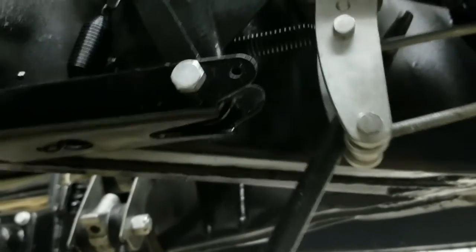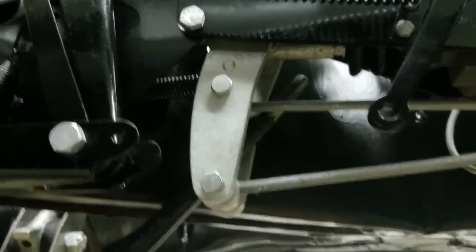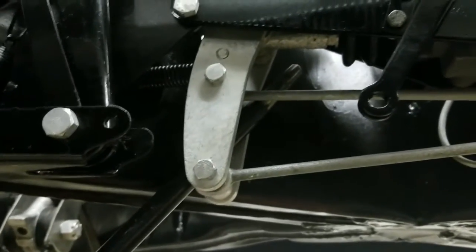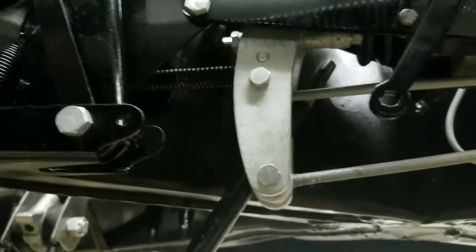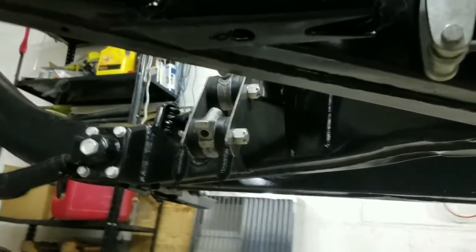When you're pumping the brakes, you put a pry bar in there as such, and then you can pump it like this. An interesting thing about this, after you bleed your brakes, if you pull it and it comes back easy a ways, then it gets hard and you pull it again and it's less and you can pump it up, that means you've got air in the system. So just a highlight, but that covers a little bit more of the pumping of the brakes.